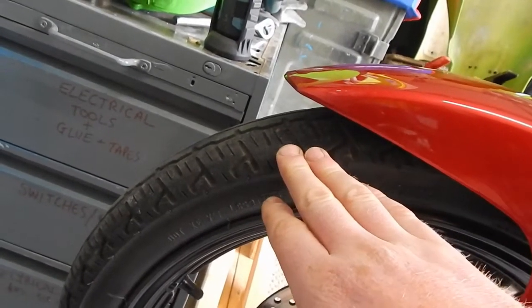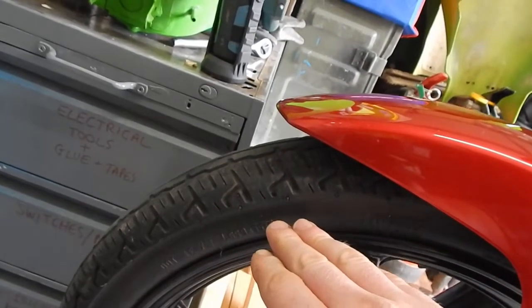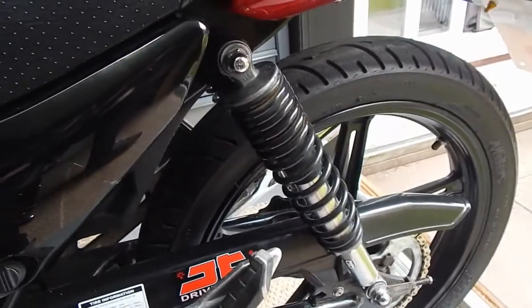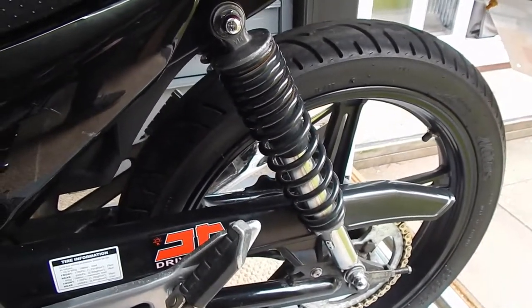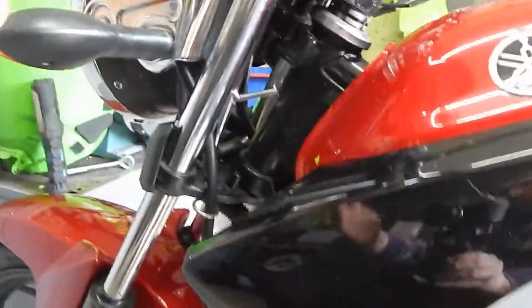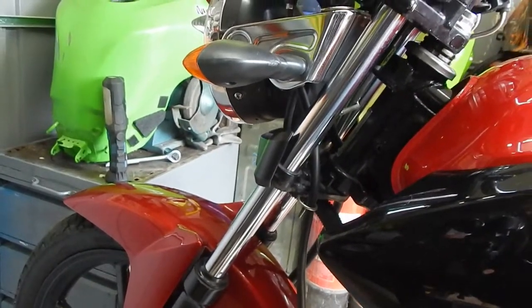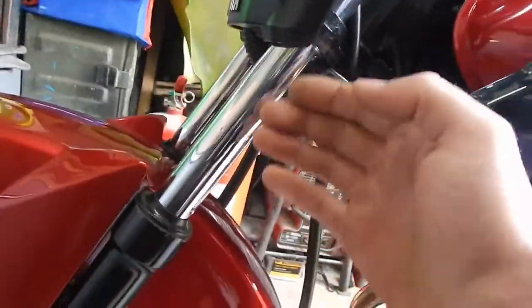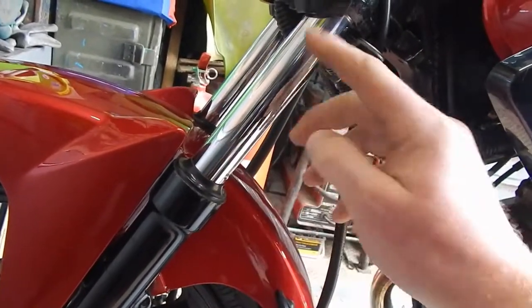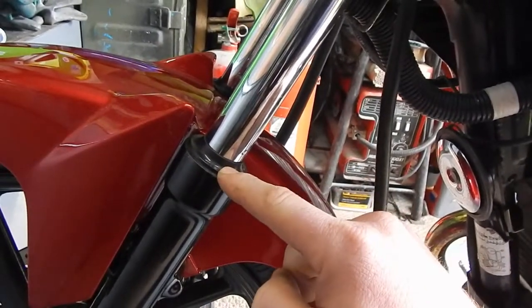It's recommended you don't keep a tyre any longer than three to four years maximum, though that depends on manufacturer specifications from the vehicle and tyre company. For suspension, it gets a little different between bikes — not all have twin shock; some have monoshock, some dual linkage, and some older BMWs had a cantered shock in the front with rigid fork brace. Starting with the front forks, look down the stanchion and ensure there's no excessive oil leaking from your seals. The top dust seal is different from the fork seal — don't get them confused.